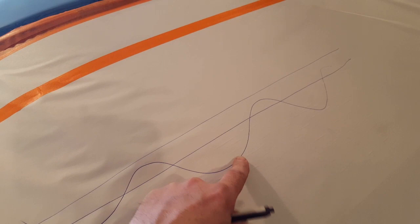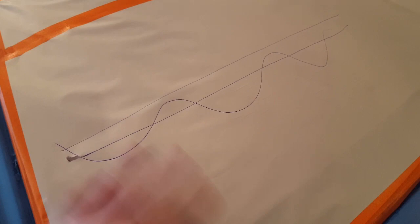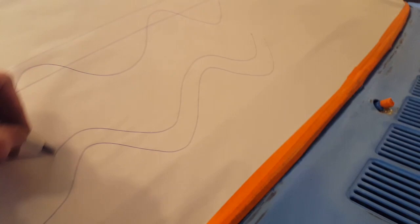And how you can see this is when you prime your vehicle, after you put three coats of primer on it, if you can still see your bodywork, it's not bridging. But if it covers up all your bodywork and all your scratches and everything disappear, you're going to run into it. So if you've got this going on, your primer should be like this on the car. Now that's a bit exaggerated, because when you cut it down, it should be cut down flat and everything, but that's what you're looking for.